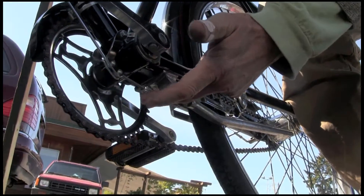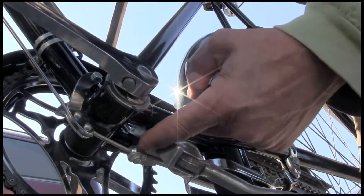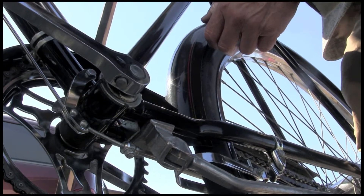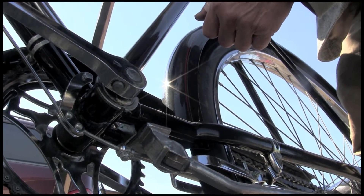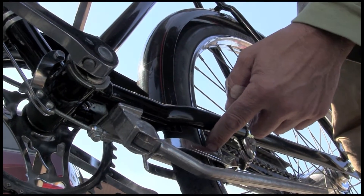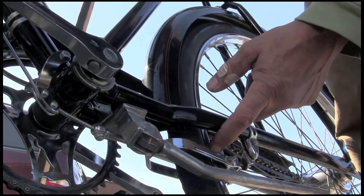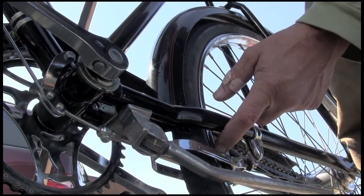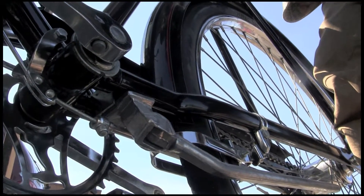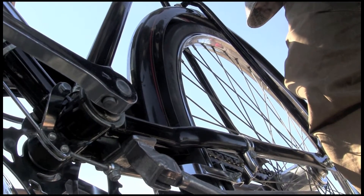This is turning into a bunch of flex here because of the bend in the rod, and you want all these rods to be nice and straight so that when you get that lineal pressure on things, it's all going to your brake shoe. All that energy from your hand isn't going into straightening linkage out, and that way you get a lot more firm feel when your brake shoe hits the rim, and the brakes don't seem so squishy.